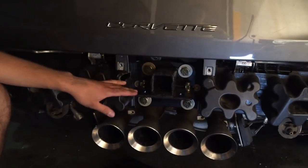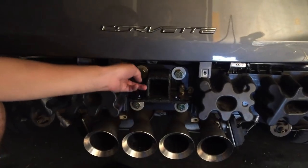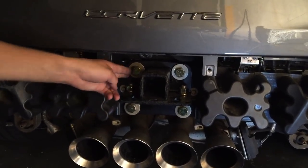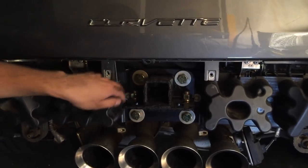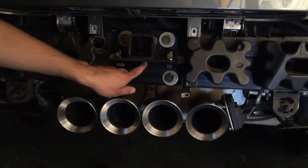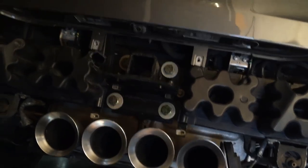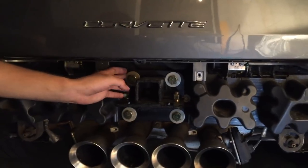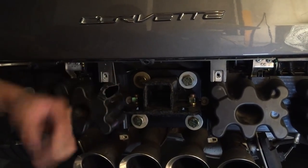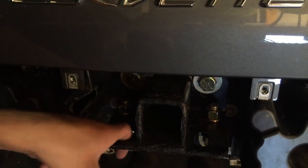This is what I came up with for a design. I was able to find this trailer hitch bracket — I think it was meant for a pickup truck — that just had a 90-degree face here, which is what I was looking for. It was about 20 bucks at Walmart. I essentially used the areas for mounting your chains as actually mounting it against the frame rails. I also had an L bracket that I purchased and drilled holes in to bolt to this, making sure I had four bolts holding this to the frame. These are five-eighths inch bolts, about four inches long, so they go all the way through the frame. On the back I have backing plates and washers so it won't be able to pull through. I also repurposed the holes that were mounted on the trailer hitch for the chains.